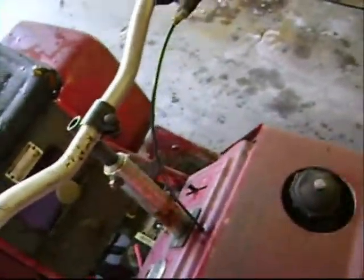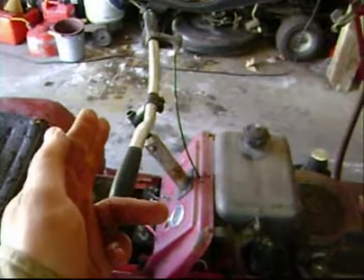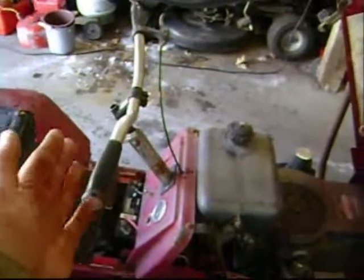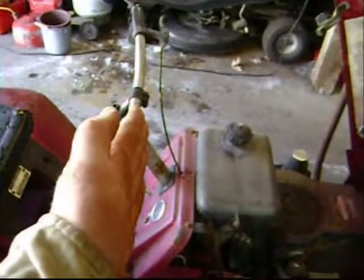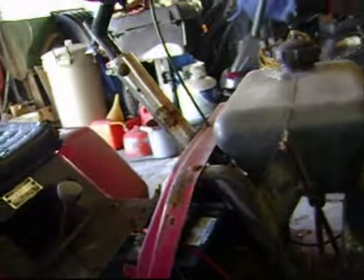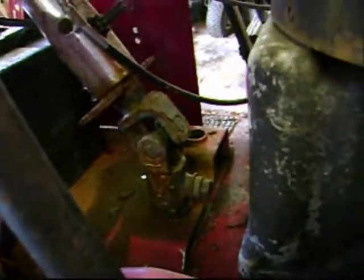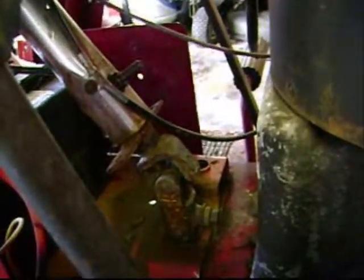So right now, the major issue we've always had with this particular machine is the steering. Now, my blue mower, the steering axle, or whatever you want to call it, is not as angled as this, it's a little straighter, so it goes straight down through the bottom of the frame. This, because of the extreme angle, and we wanted to keep that, was held on here by a universal joint that came from a pickup truck,